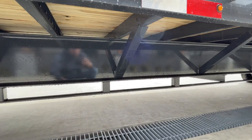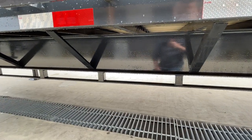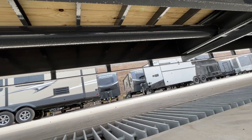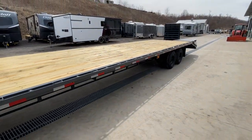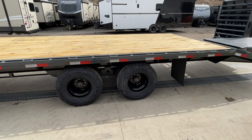The under-frame bridge on this size is standard — done a little differently with tubes. You've got outriggers on roughly a 3-foot center. The under-frame bridge is for spreading weight on a concentrated load: if you had a heavy load on only an 8- to 10-foot section, it helps support your beam. Underneath you've also got a torque tube — looks similar to a well casing, about a 6-inch round pipe, running from pretty well up front back to your axles, with a cross member in the middle. That's more for off-road use — keeps the trailer from twisting and torquing in a farm field, hence the name. The trailer comes standard with both the under-frame bridge and the torque tube.